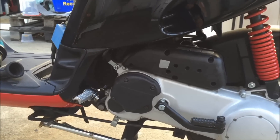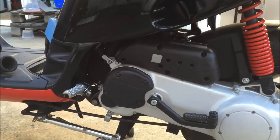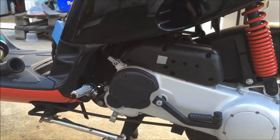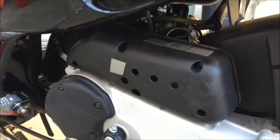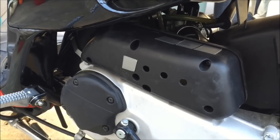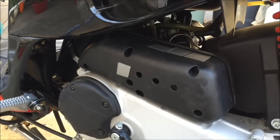This mod does require rejetting, so it will cost ten to fifteen dollars for new jets and some time to rejet your carb. Apart from that, this is by far my favorite mod because the engine really wakes up from it. On the downside your bike will be a lot louder, so it's entirely up to you, but the good thing is it's reversible. You can see here — this is the airbox, and this modification applies to most bikes. I've done it to my Ruckus before I changed it to a pod filter, which was really just for looks given the exposed frame. This is a fairing bike I ride to work, so I'd leave the airbox as-is and not install a pod filter.